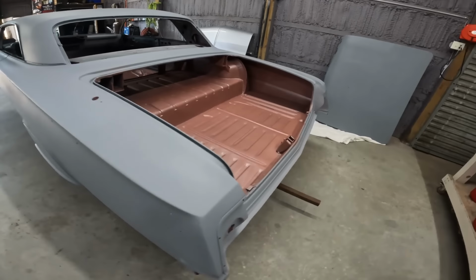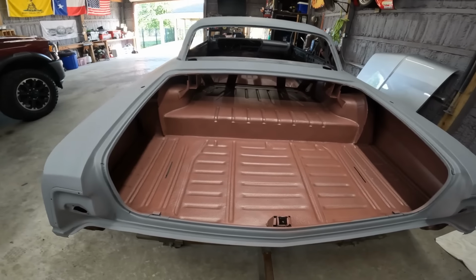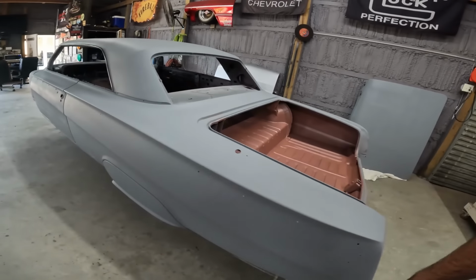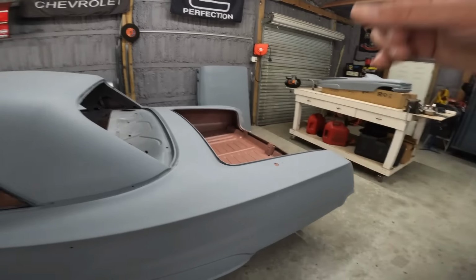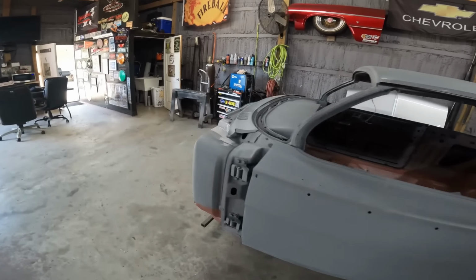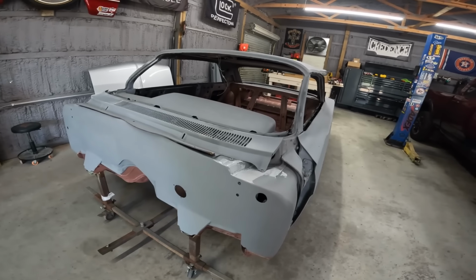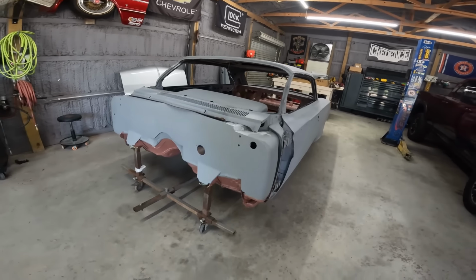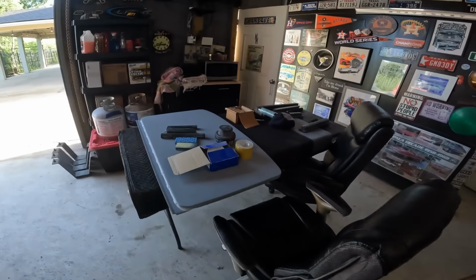Where we last left off, we got this thing all Raptor down, Raptor liner, tintable. That was in last week's video. Today what we're going to do is guide coat the entire thing and wet sand. The deck lid, moonroof cover, the whole shell, fenders, hood, dash, cowl, everything in preparation for paint. Skirts, firewall, pretty easy.